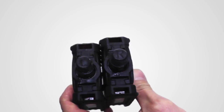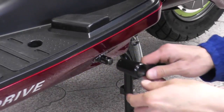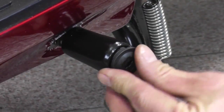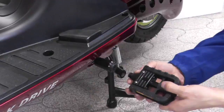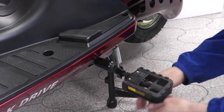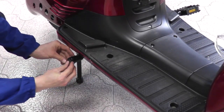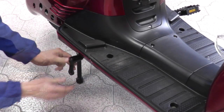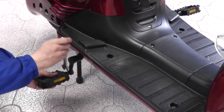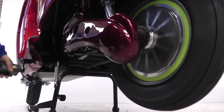This bike does not have similar pedals or pedal cranks. The last pieces you need to install are the pedals. Attach the crank by pushing it in and place the cover on. Then attach the pedal and tighten it with a wrench. Repeat these steps on the other side. Note that the pedal cranks should be parallel and pointing in opposite directions. Attach the pedal and tighten it with a wrench. Check to ensure that the chains properly spin when the pedals are rotated.